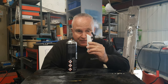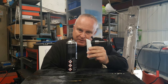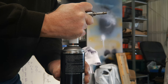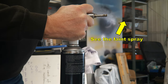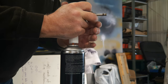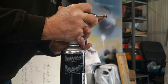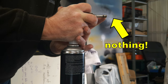And here is the bonus test I promised you. Fit your injector — or leave your injector fitted to the adapter — but without the power lead. Hold your injector firmly into the adapter and press firmly down on your can, preferably a full can. You should not see any fuel coming out of the end. This injector is clearly a leaky injector. And just to demonstrate that this does work as a leak-down test — if I put this injector on and press down, you will see there is no leakage coming from this injector, so this injector is fine.